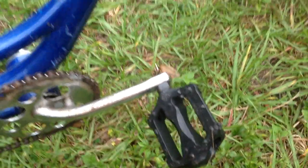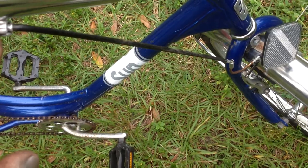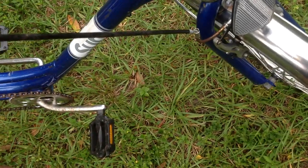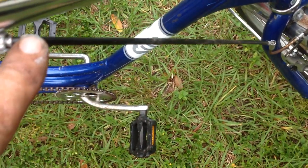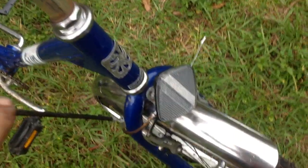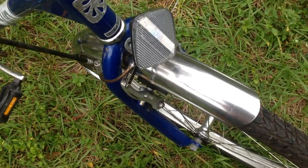I'll drill new holes for the two mounts, front and rear. Also, the front brake was not working, so I stole this cable off of a BMX bike. It is a little short, but it is working. It should be another five or six inches longer than it is, so I just moved the handle closer to the middle to give me some slack and adjusted the cable accordingly. So it stops on a dime — good reflex there on the cable.